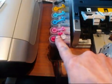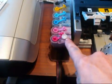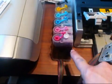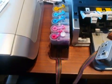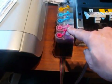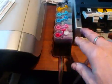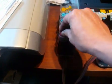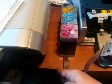You remove that rubber bit there and you put that bung in there. You must do this — if you leave those small rubber bungs in there, no air can get in so no ink can travel. What these do is stop the ink flying everywhere if you accidentally knock it, but they do let the air in. When you're filling up, you just remove this big one, fill up your ink, and put it back in.